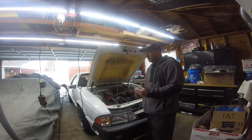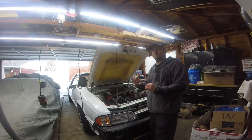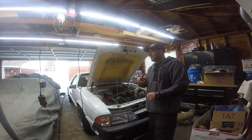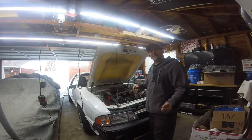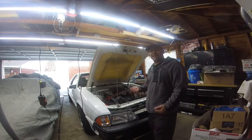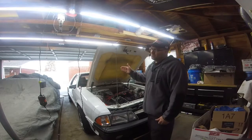The struggles I have with starting the back is mainly just getting the old bolts out of the sleeve. With it being so old, the bolt rusted inside the sleeve and it would just turn. Luckily on the rear, I just hit it with a hammer or a sledgehammer and keep at it, and you finally get it out. It takes time.